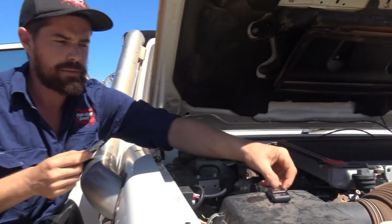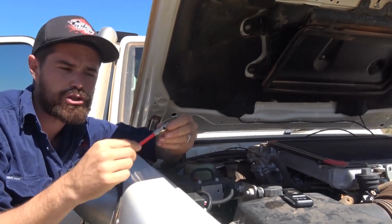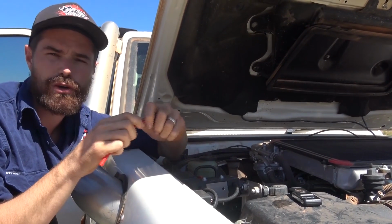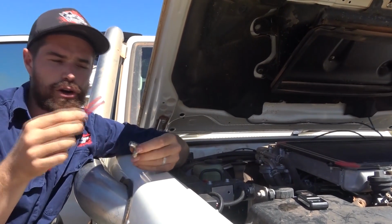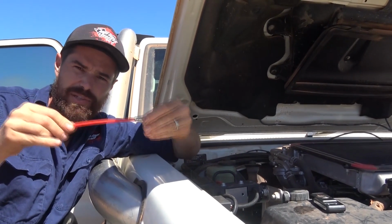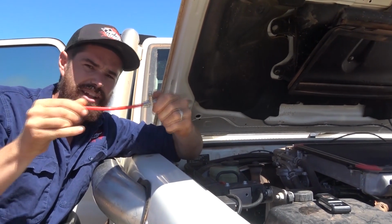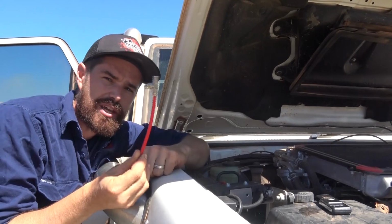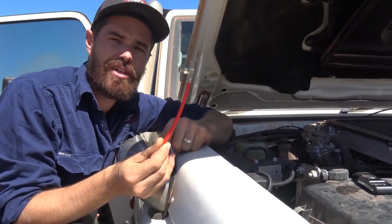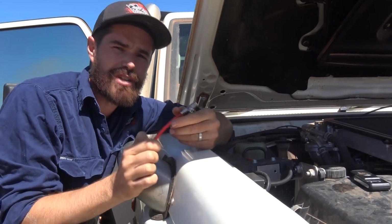And if you haven't seen it before, the Airbag Man setups, it's all click and connect. So this is a similar 3-way junction, and these are the hoses. All you do is cut your hose flat, plug it in like that, and it's self-sealing, and that's 100% sealed, no leaks or anything. There can't be a simpler thing to set up than these airlines that Airbag Man have set up. Along with that, their instruction manuals are next to none.